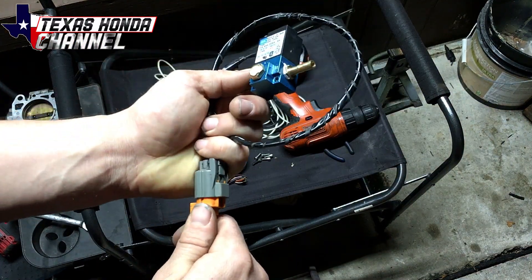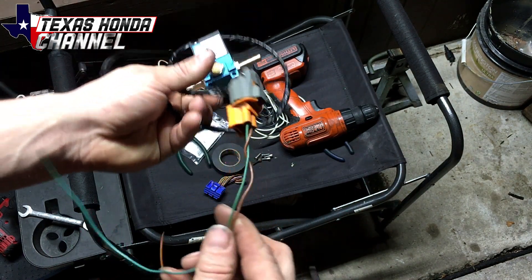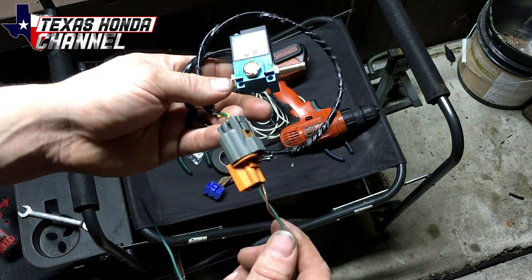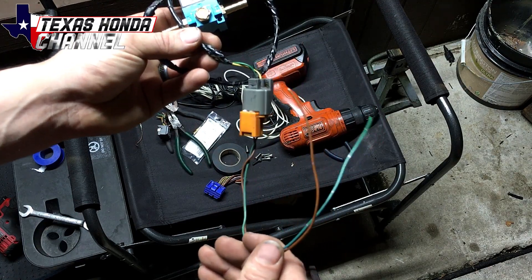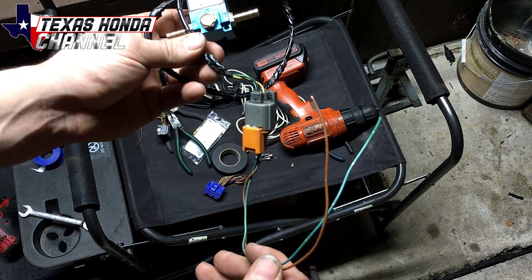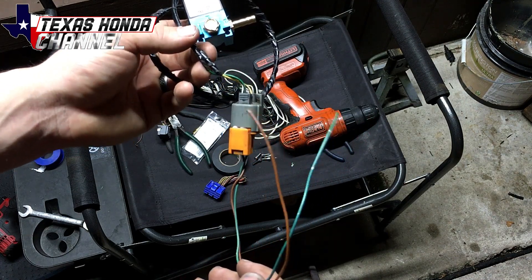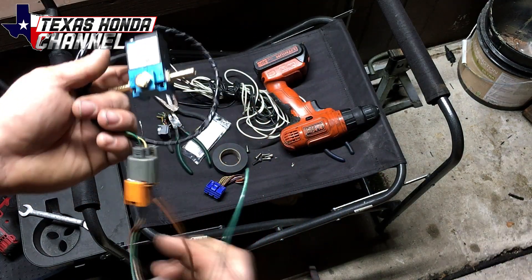I have a connector from another engine harness — I have tons of wire connectors — just any two-prong connector connected together. That's how I'm going to run this one. It doesn't matter which one's negative or positive on this, so either one of these can run to the ECU for the signal, and then the other one can be direct power — a 12-volt source. I'm going to show you how to wire this directly to the ECU.